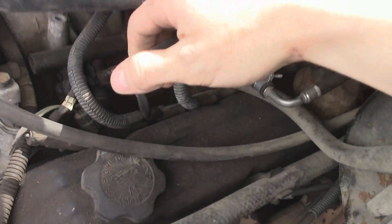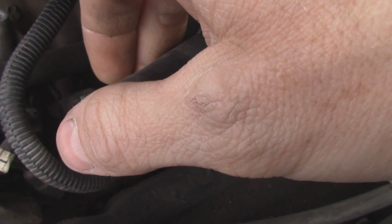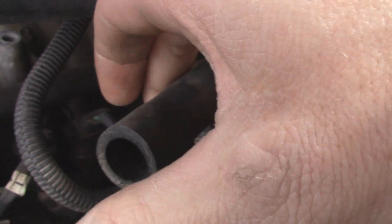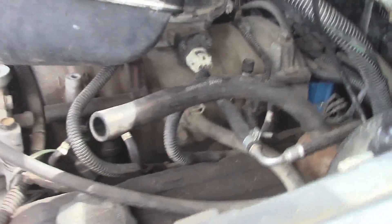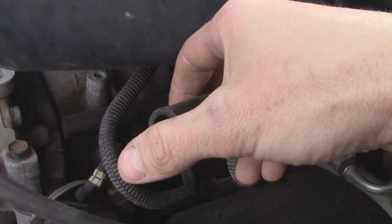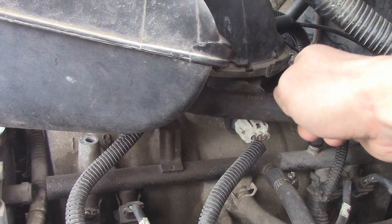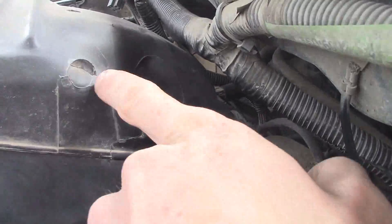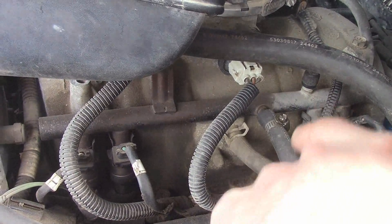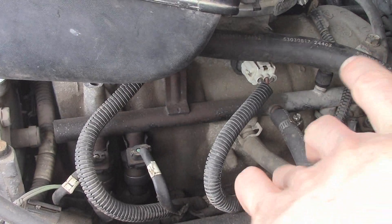You're not going to want to run it long. It was sucking my thumb quite good. That is how we diagnose whether or not that gasket is breached. Another thing you can do is unscrew your air filter assembly, open up your throttle body, and stick a magnet down. If it sticks to the bottom there, you have the stock steel plenum plate. If not, somebody's upgraded it to aluminum. If it's still leaking, you just need to replace the gasket.